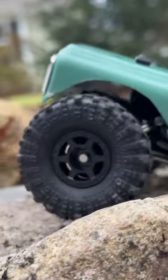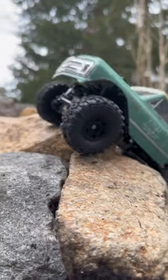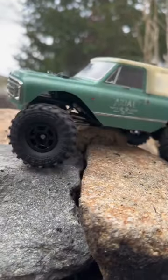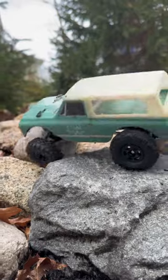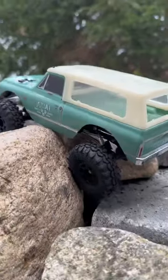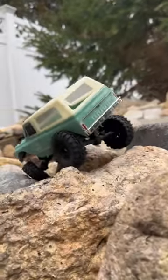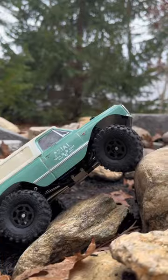On the rocks they hook up okay, but they're a little slippery. These are more at home on looser terrain — mud, sand, dirt — those types of things. With the big gaps between the lugs, they'll clean out really well in those scenarios. There's not a lot of flex in these tires; they could really benefit from a proper setup with a heavier wheel and some venting, but overall a good tire.